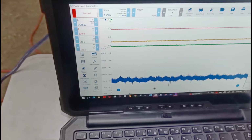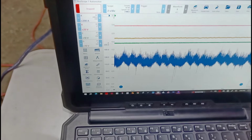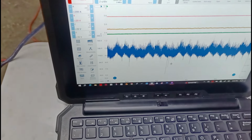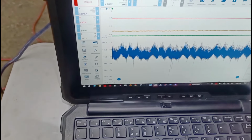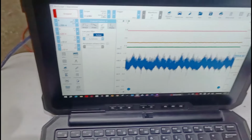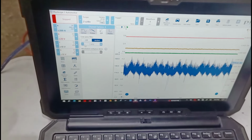I still have a compression issue. I'm only seeing like three strong peaks with one dead peak. So that's also letting me know that I have a dead hole in my cylinders. Let me see if I can clean that up, so you can see exactly what I'm seeing.